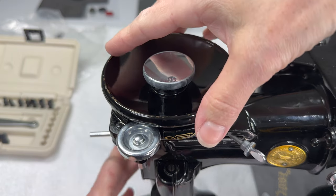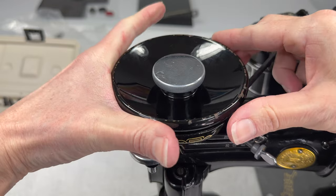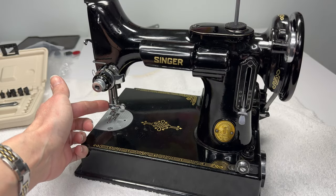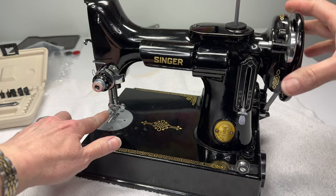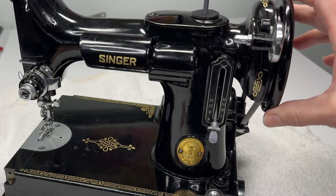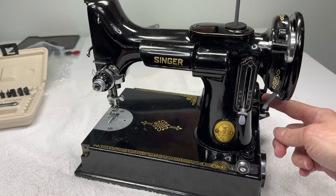Final check: I'm going to lift this up a little bit. I can spin it and my needle bar is moving when I spin it. But if I hold the hand wheel with one hand and turn the stop motion knob counterclockwise until it stops — stop motion is engaged. We turn the hand wheel and the needle bar doesn't move. Turn it back on and the needle bar moves. So that's what you should have happen when you put your belt on, and we're going to adjust this belt next.